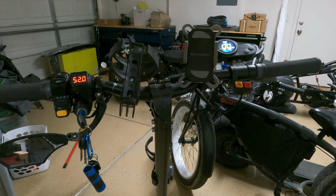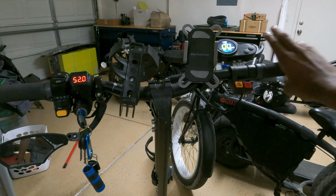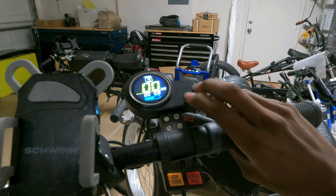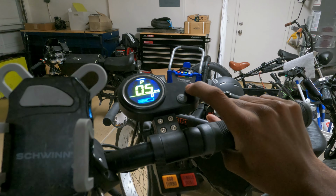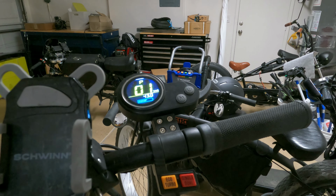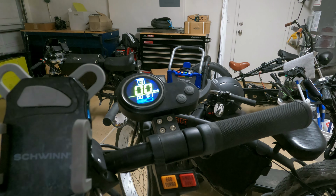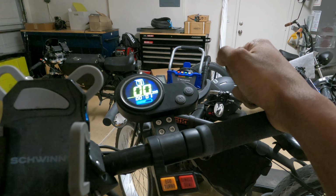The last video I did upload, I got some comments on it. Some of these comments really did help out, at least one main comment. But in the last video, I had a couple people asking me to check the P settings on this thing right here. Now, let's pull the camera a little closer, but I could have sworn I had checked already. But if we go in here, let's see which setting it is for the voltage cutoff. I think it's, no, it's not 9, it must be 1. Yep, it says 43 right here. And if I'm correct, the comments did say the setting to change the voltage cutoff is P1. This P1 says 43 volts.